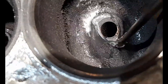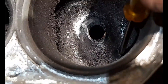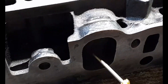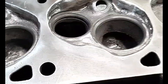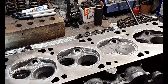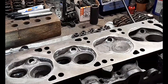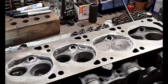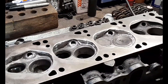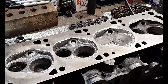Then I'll be cleaning all of these castings in the bowl completely — all the castings still on the front of the boss runner. The whole boss will be cleaned now that it's been thinned. Then I'll use the long shank tapered burr to go in the front of the runner and clean all the roof, floor, and sides all the way into the bowl. That's how you do the intake — very similar to how we did the exhausts, with the tapered long shank carbide on the pneumatic tool, then smoothing the runners with a stone. That is it for the intake runners, thinning down the intake valve guide bosses, and blending that bottom seat machine cut into the bowl.